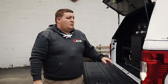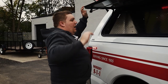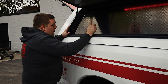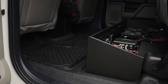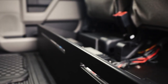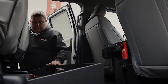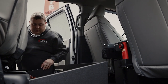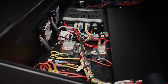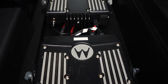Another pin switch installed on the back cabinet so that we're able to turn the compartment lights on. This is the heavy-duty ARE cap — you'll see that it has a track system in it to give us a heavier-duty aluminum shelf, which is very nice. Diamond plate. Another FireTech compartment light mounted inside the compartment to give them lighting. As with all of our builds, accessibility is key. We mount our electronics underneath the rear seat of the pickup truck, giving us a great place for the chassis to mount, which gives you accessibility to reprogram or service them. We also have our main distribution for our lighting and siren system with all of our fuses, our Blueprint 500 amplifier and relay box, allowing us to mount everything for future expandability. Our electronics compartment is made out of HDP material, fully welded, designed to fit the truck.